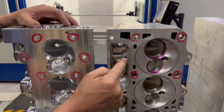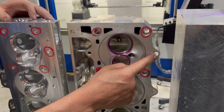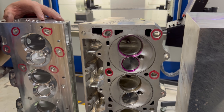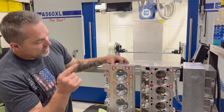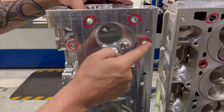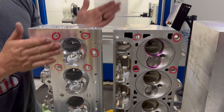This little piece right here has no clamping force — it's minuscule, doesn't mean anything. This one out here rarely means anything; it's just a stupid little three-eighths bolt usually torqued around 35 or 40 pounds — useless. These are the only four bolts that are actually holding every typical LS engine-based program except mine. You can see this is a significantly better clamping area and clamping load than what the standard LS has.